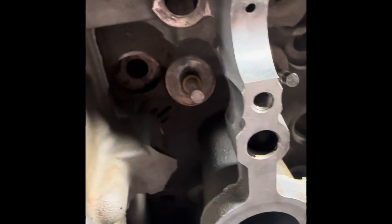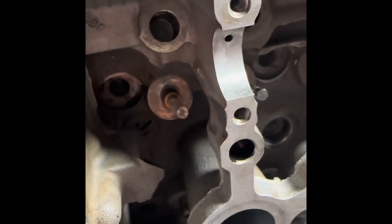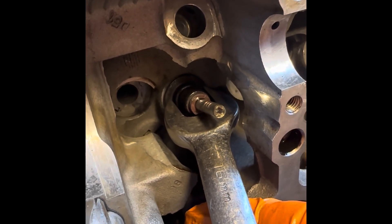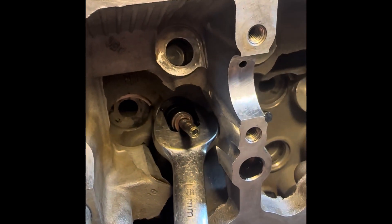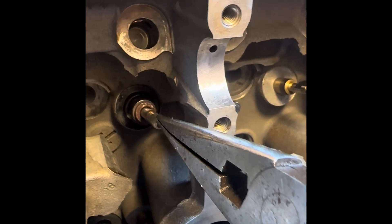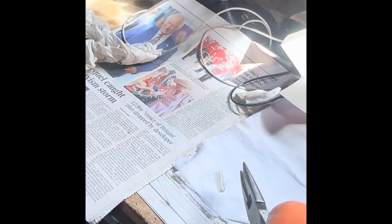Put a little bit of oil on that as well. You can see the plastic is on there now. So now I'm going to slide that on and I'll just use a 16mm spanner and push it firmly down to seat it there. That's seated firmly down there. I put a little bit of oil on the inside of that just to ease it on. Let's get a little pair of pliers here and pull that off. Alright, this is good to go. Always keep this clean - put it on a clean rag so you don't get anything in there.